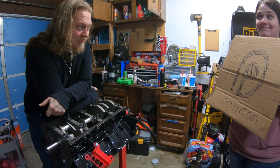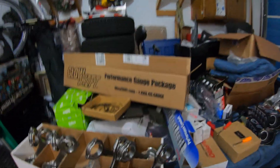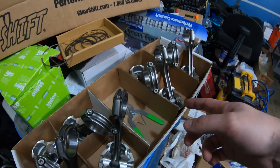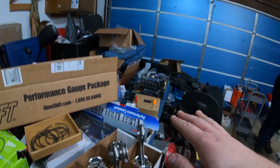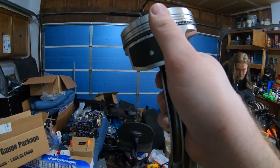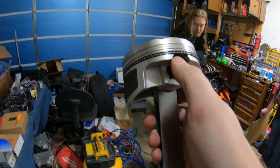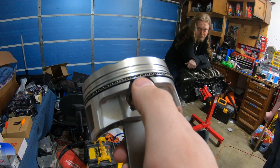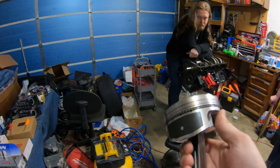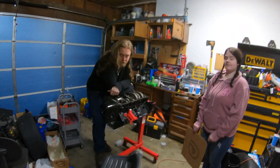Isaiah finished grinding all the piston rings we need. We got our second rings - these all have top rings which we'll have to remove, but that's not the end of the world since it's easier to stack from the bottom up. We figured it out after watching some Summit Racing YouTube videos. There's a spacer ring under the oil ring, then a scrubber, then the oil slicker, then another scrubber - so there are four rings on the bottom portion. Then we put the second ring and top ring on.